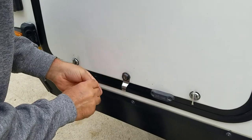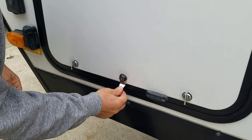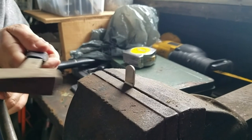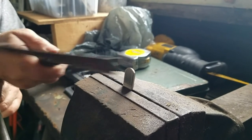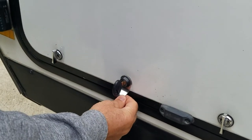Orienting the latching arm isn't difficult, but there's going to be some difference from one model to the next as to where the small latching arm needs to be as it locks onto the trailer's door frame. The door's thickness and the wall's thickness can vary a bit between trailer models, so you may have to adjust the latching arm to suit. I had to bend mine only a couple of millimeters and now it feels really good — I can feel just a small gap that tells me it's properly adjusted.